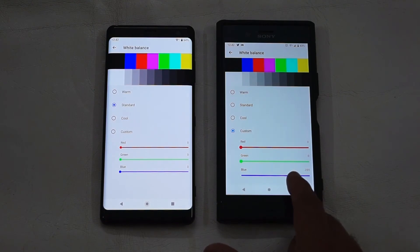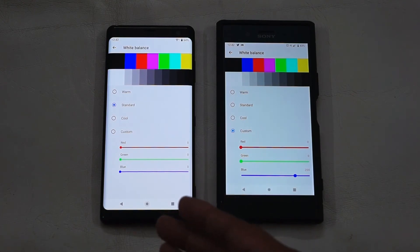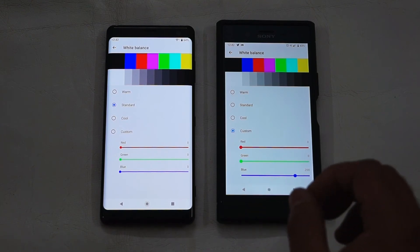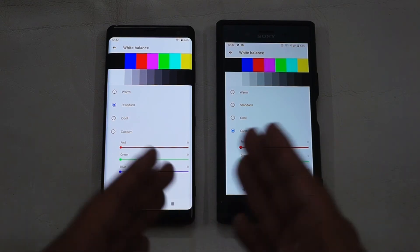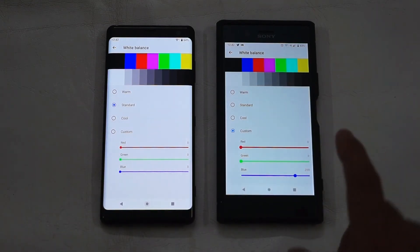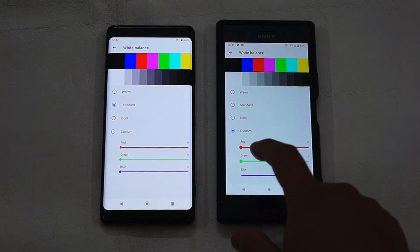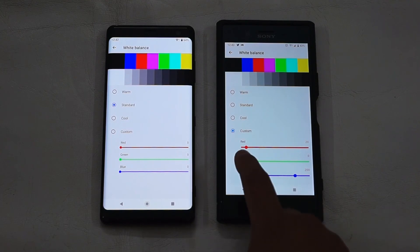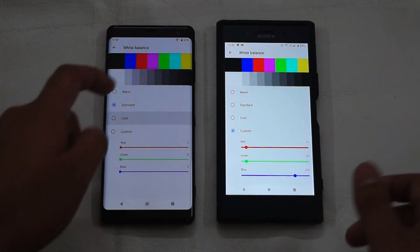This is about a value of 200. With this setting, even though it is not exactly the same as the XZ3's screen, it is pretty much close, because the blue color has been neutralizing the yellow tint of the XZ Premium screen and it is now very close to the XZ3's. Now if you want to bring a bit of a yellowish tint or a warmer tone on the XZ Premium, try increasing the red tone by 20 numbers and green also by 20 numbers — that will bring a bit of warmth to your phone.